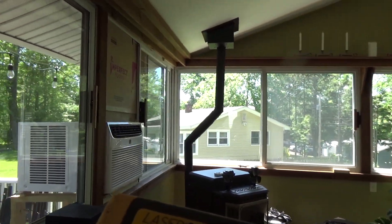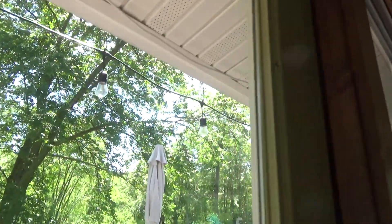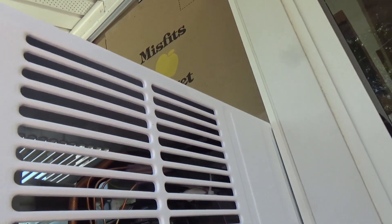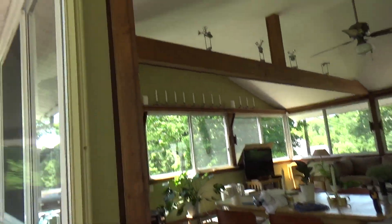So I rest my case. The filter's not dirty. The drain hole's not causing it to overheat. And the charge is not low. See that? It's sweating — it's coming back to the compressor cold. So therefore it's not out of charge, undercharged, or incorrectly charged. It is charged properly and the refrigeration system is working properly.